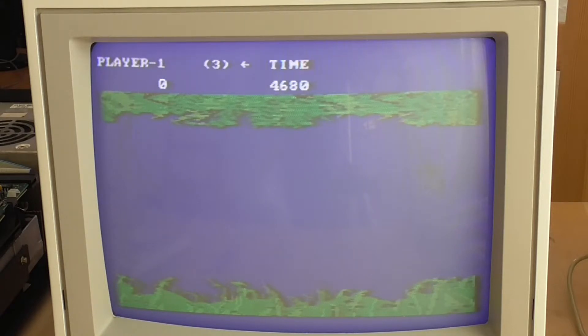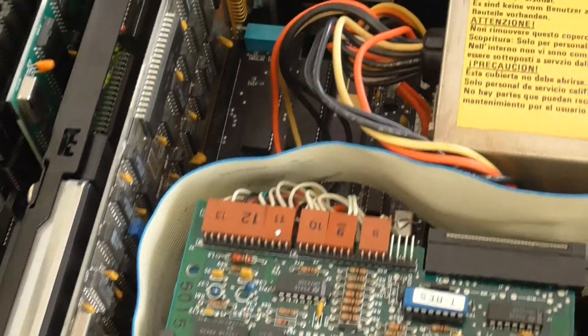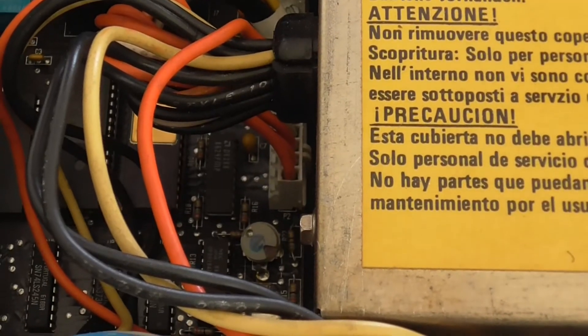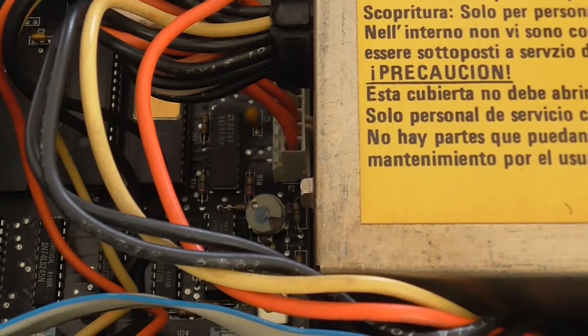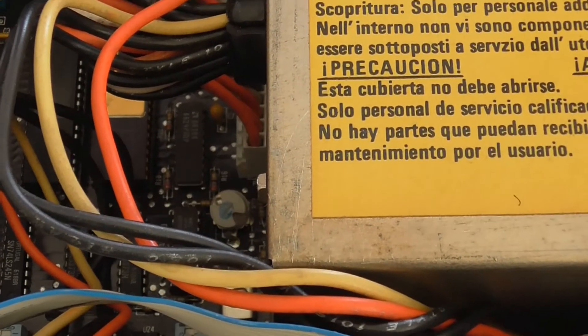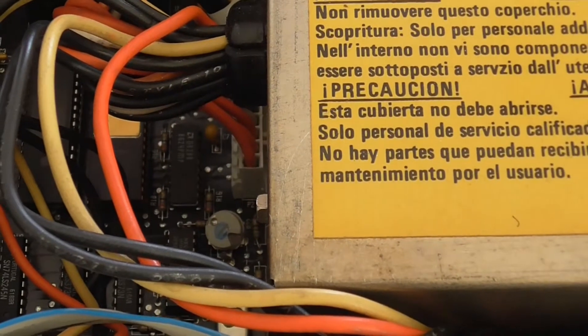I had a problem with this particular machine — when I first plugged the adapter in and switched it on I was just getting black and white. It turns out there's an adjustment you need to make, at least on some machines, in order to get it to work. Unfortunately on my machine the adjustment knob was actually broken. Inside the IBM PC 5150, past the floppy drive near the power connector, there's a little round circular thing with a screwdriver slot — a little trim pot which adjusts the frequency for the graphics card. That trim pot changes the way the colors are displayed, and for some monitors and adapters, unless it's set correctly you'll still see black and white. You have to twiddle it until you get color on your monitor.